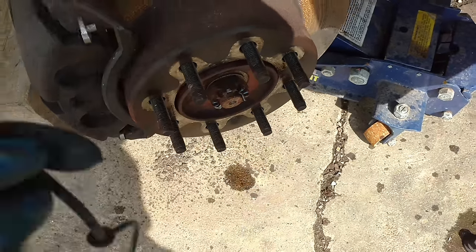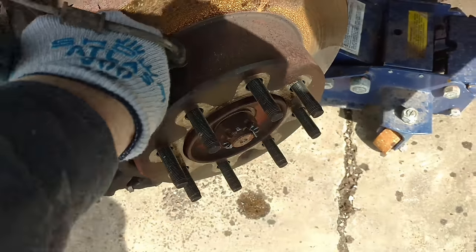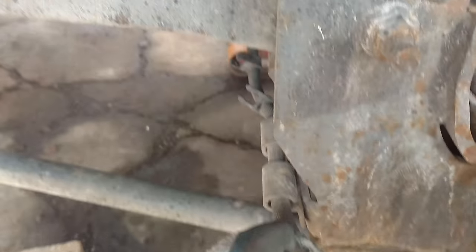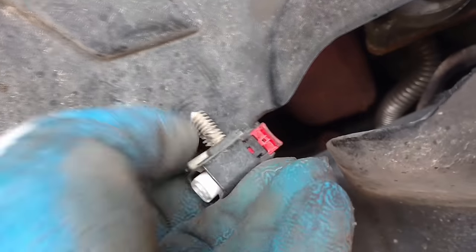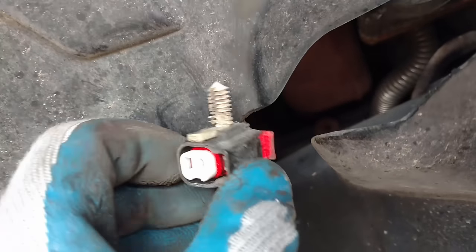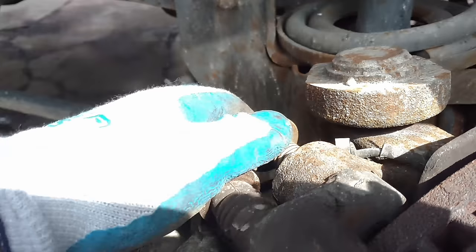I got the adapter off. Next I took the ABS wire loose — it's sitting inside the brake hose here, just pull them out and then they go up into this connector right here. You need to pull this little red tab back before you push in on it — it's like a second lock. Take that out. The caliper bolts are 24 millimeter.